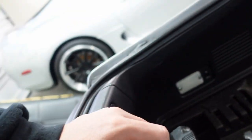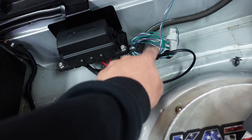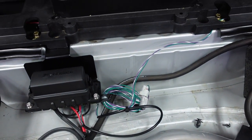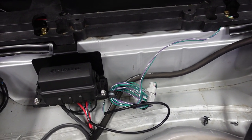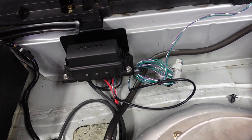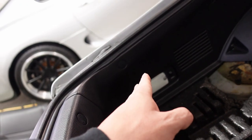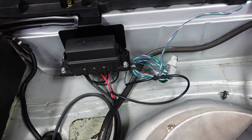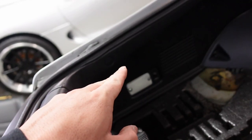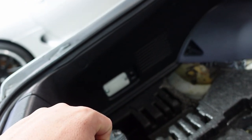You just have to take this back piece off, the cargo top holders, and then this piece here — you just pop these little covers off. It's just a factory fuel pump wiring trigger. Now that's only for dual pumps, so even the setup I have now I'd need to run another trigger. Part of me is thinking: leave that wiring for now because I might need a third pump. I can use those two triggers up front — they're right up front — but I can't do three pumps with that wiring that's in there.